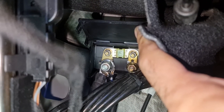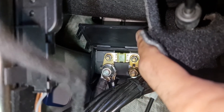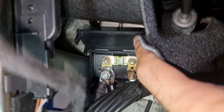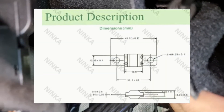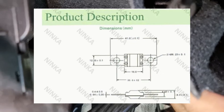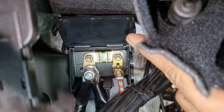This is the 40 amp fuse I'm talking about. On the left hand side I've got power; on the right hand side I have no power. These are midi fuses — center to center of the hole they are 30mm, and 40mm overall in length.